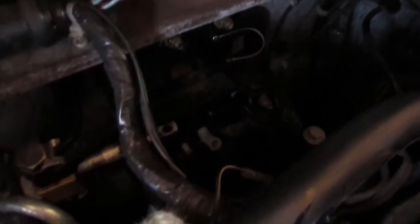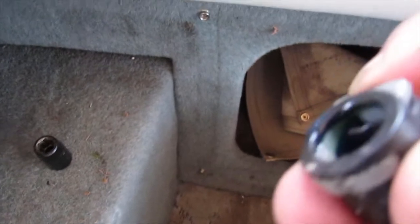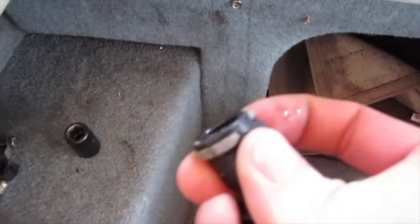Alright, now on the inside of the boat, yes, you do have to do stuff on the inside. Right down in there, that fitting, there's two bolts and a small plate which looks like this, along with the grommet, a rubber grommet around the water hose fitting. So one thing I did that was stupid is that down beside the water pump fitting, there is the fitting for your oil monitor hose. And yes, you bet, I did snap it off because I was pulling on it. I thought it was a barb, but it turns out it's a user-friendly little fitting.